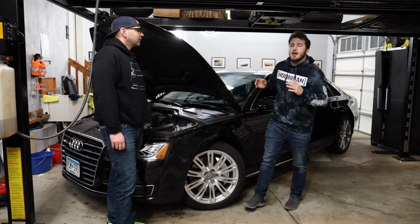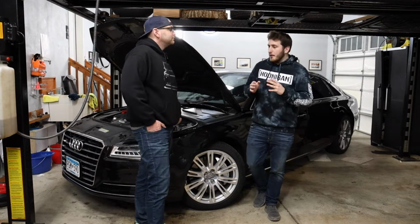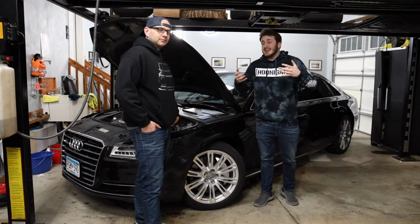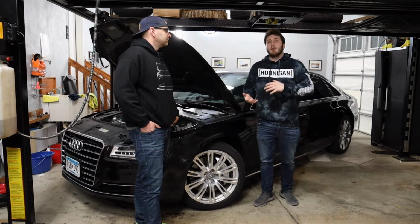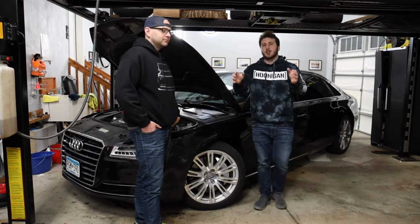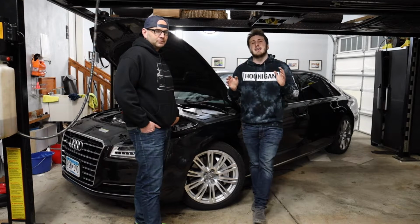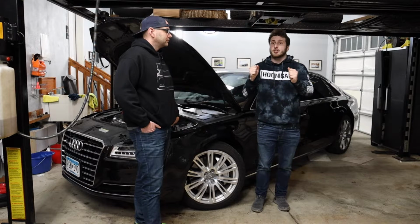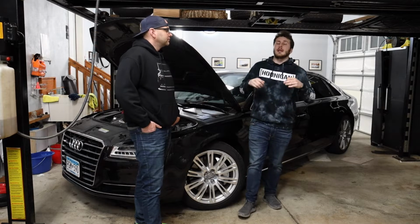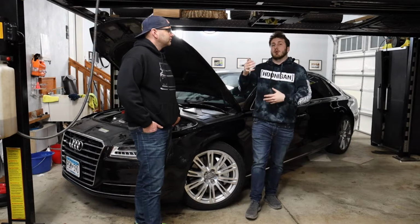He always has been. However, right before we get into explaining the rest of this story, I just want to let you guys know how to properly diagnose what is going on in your Audi's suspension and the easiest way to figure out what is wrong with it before you just start ordering parts. The easiest way to go about this is to jack the vehicle up, and you're actually going to take both of your hands and shake the wheel back and forth, side to side. If you can feel any movement beyond the wheel actually turning, it means that there's most likely a suspension component loose. When there's side-to-side movement, it usually means an outer tie rod or an inner tie rod. It can also mean the upper and lower control arm.